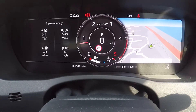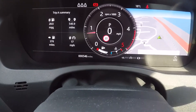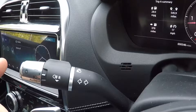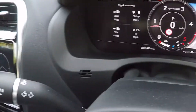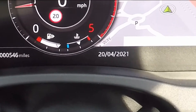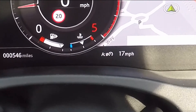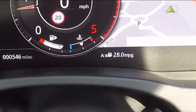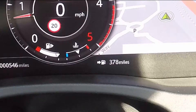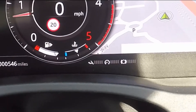This one took me a little while to find, but if you want to reset your trip computer, the way you do that is by pressing the button on the end of the wiper stalk. Press it once and it turns that display off. Press it again and it shows the date. Again, now it's showing the miles, the average speed, the average miles per gallon, and the current miles per gallon. Then it shows the amount of fuel left in your tank.